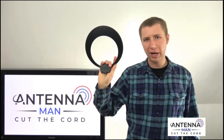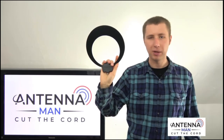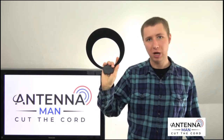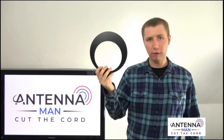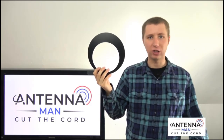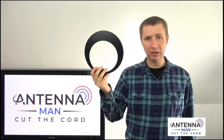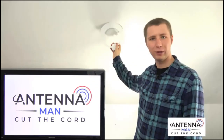So as you can see from my test, this antenna performed pretty well on the UHF band, but did not do that well on the VHF band, exactly as I expected it to without the proper VHF elements. Now there are some markets that have all the major TV stations on the UHF band. Maybe they only have like one religious station on the VHF band that no one really cares much about. If that's the case, this antenna would work pretty well for you, especially because it's almost invisible putting it on the wall.